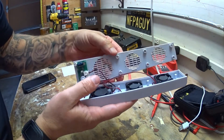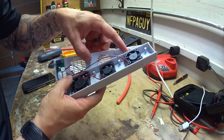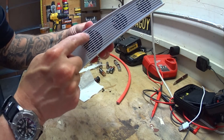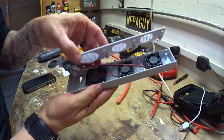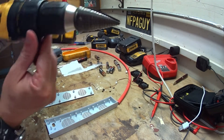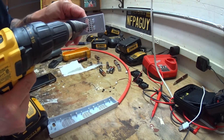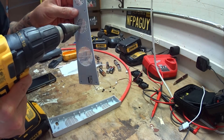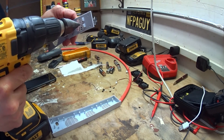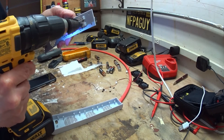What we'll do now is to allow for even more airflow — I'm just going to find a way to see if we can use a hole saw or a unibit or something and just kind of cut these open a little bit more. It won't be as aesthetically pleasing, but you don't really see it on the back of the PlayStation anyway. I'm going to go ahead and cut both sides out and see if we can get as much air flowing through this thing as possible. What we have here is a unibit, or some people call it a step bit, and I'm just going to simply see if I can drill through these holes. I don't need to make it the full size, but just something to get rid of some of these grates. Just give it a shot.